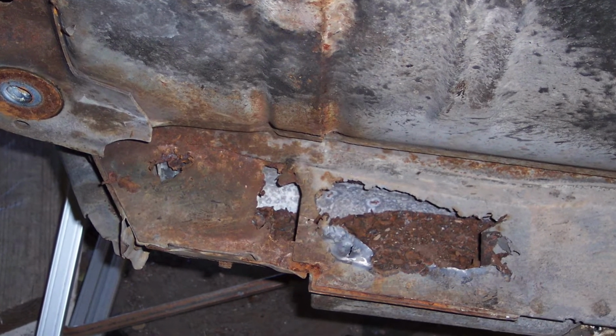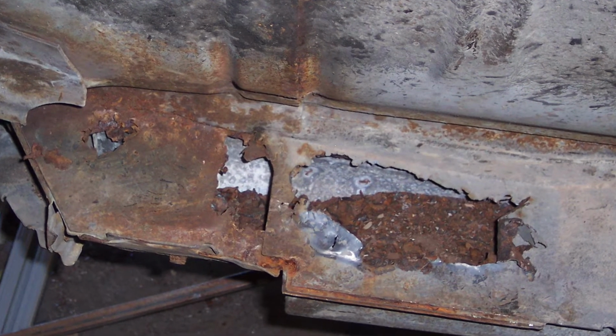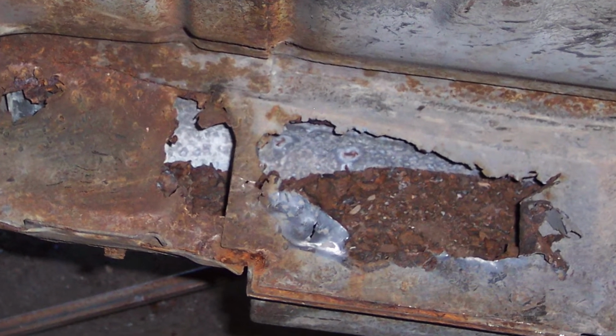Yes, at the A-pillars, there are several layers of metal in there, and you can see in the inside of this rocker where just by tapping on it, it just all gave away. There's a pretty stout sheet of metal on the inside of that, so I had to cut this area open. Fortunately, I didn't get pictures, or I've lost track of those photos. But pretty thick metal, it's like 1/16 of an inch thick, a fairly good gauge, that went up the sides of the rockers on the inside of the A-pillar, but that area was all rotted.